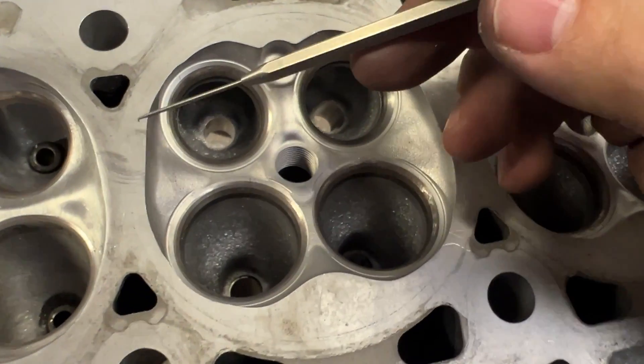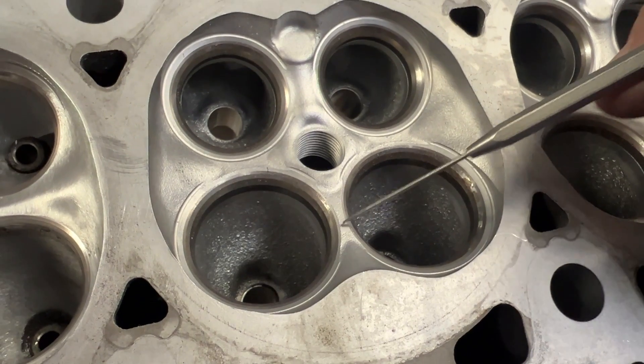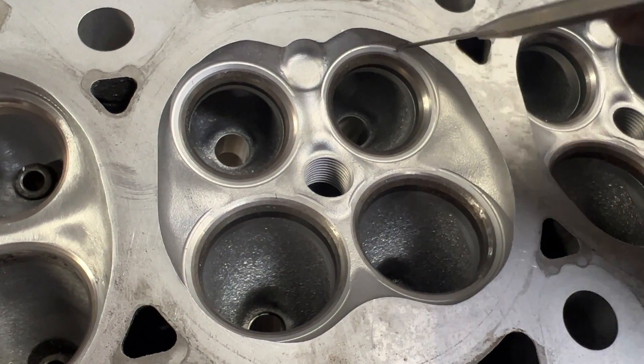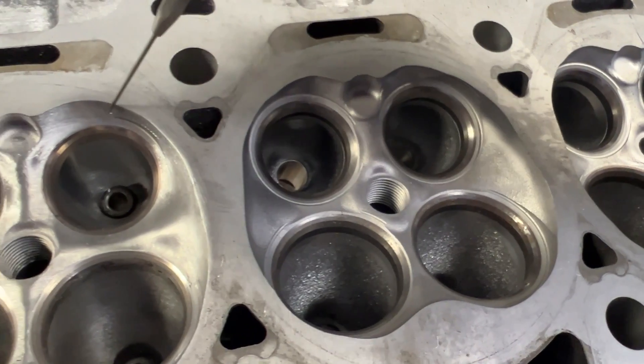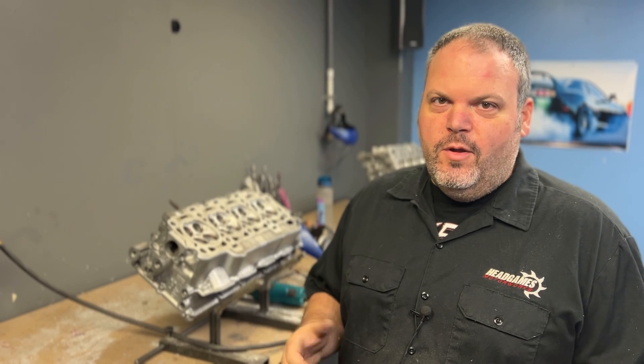Everything is deburred and the valve is unshrouded — here's the 45 and everything is looking really, really good. If you compare it to what was there before, you can see it's not round on the original, but I made it round. I took away all these hot spots around the valve seat, which get worse when we change the top angle — this is going to help get rid of detonation. I also unshrouded the valve; this one is much rounder and not as shrouded as the other. So now it's going to go back on the flow bench and off for CNC to get it digitized. We'll cut — I actually have about six sets to cut — then we'll do the whole process again: guides, valve job, the whole nine yards. We'll flow the CNC version versus this one. Unfortunately we ran out of room to include the flow bench results in this episode due to time constraints, but I promise you'll see it in a future episode. Be sure to like, subscribe, and comment below — I'd love to hear from you. Toodles!